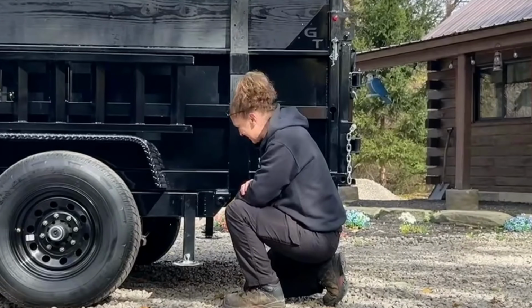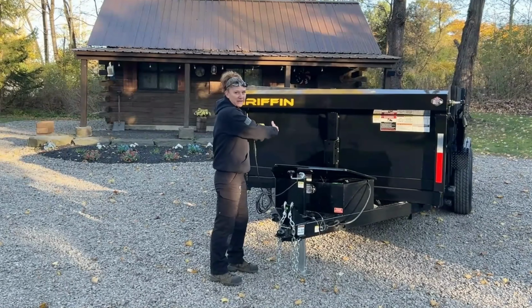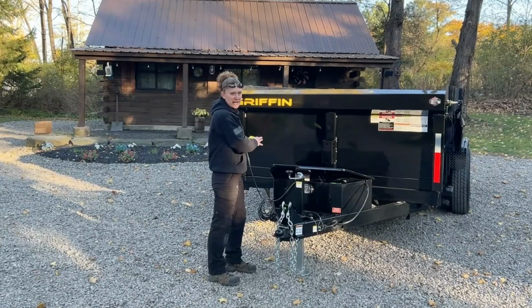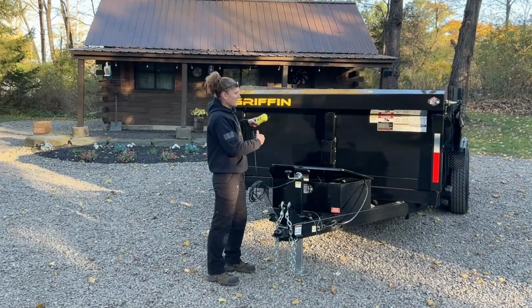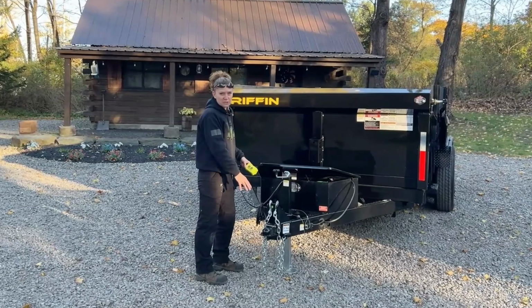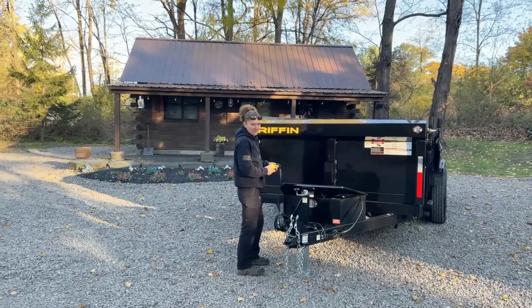a disaster. Okay, before I lift this thing up, I got a load of oak timbers on this thing, and most of the weight is to the back of the trailer. That's another reason why I like those drop legs in the back, and they're down now, because obviously I'm not hooked up to the truck, and if you want to dump a trailer without being hooked to a truck, it definitely would flip backwards if you tried. So even if you are hooked up to a truck, those drop legs help take the pressure off the hitch of the truck and keep it on the back of the trailer. Okay, let's lift it up. It's just up and down, it's simple.